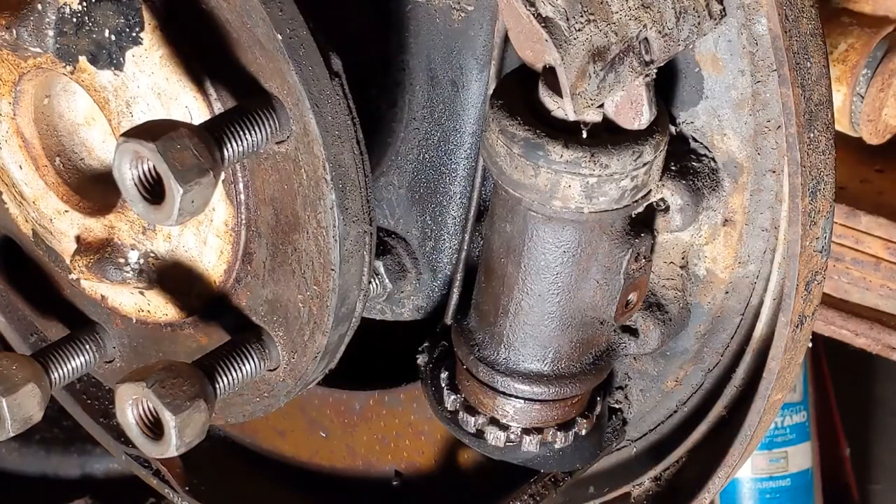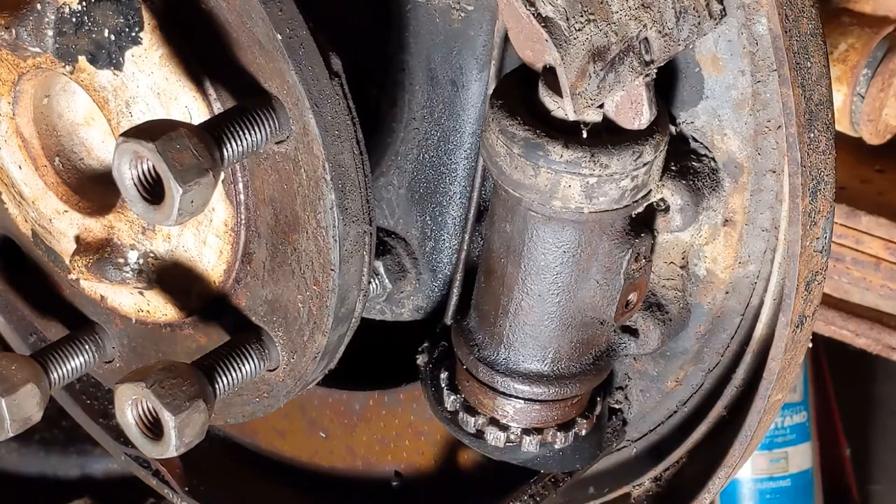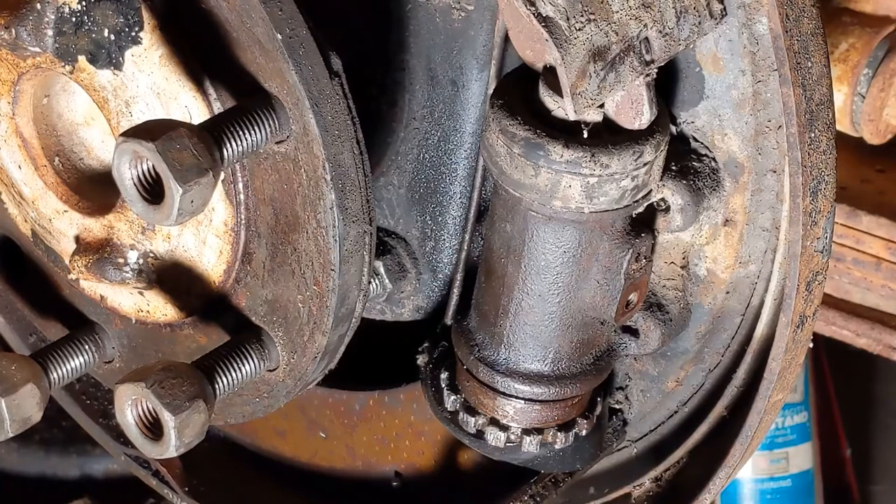I haven't had much luck. It's been about 15 or 20 minutes. I've been working it back and forth, applying more penetrating oil, and I've barely made any progress — it's still far too stiff. I'm going to go ahead and remove all of this, take the brake linings out, disconnect the brake lines, take the brake cylinders out, and put them in a vise for a closer look. I was shopping online and replacements are hard to find — about $100 a pair for one side. The front ones are ready to go, but the rear ones are much rustier, so new ones may be in order.